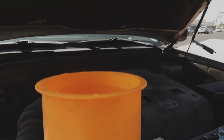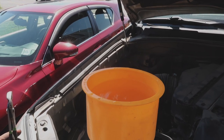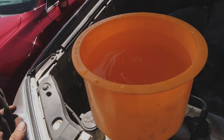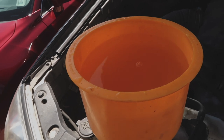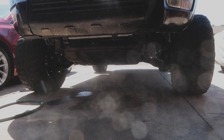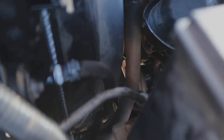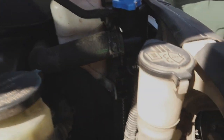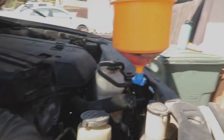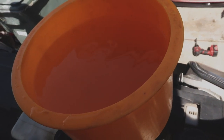Christine's gonna start the truck and we're just gonna watch as this sucks in the water. As the truck is warming up, we're gonna watch under the truck to make sure there's no drips, no leaking hoses or anything. Looks good. You can see there'll be little bubbles coming up — what it's doing is sucking in the water and releasing the air straight through this funnel.